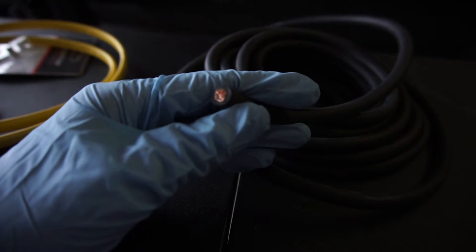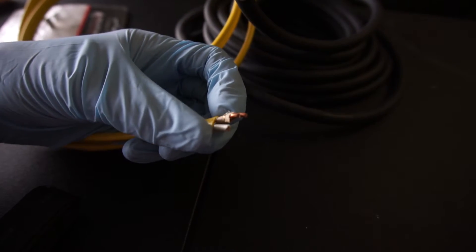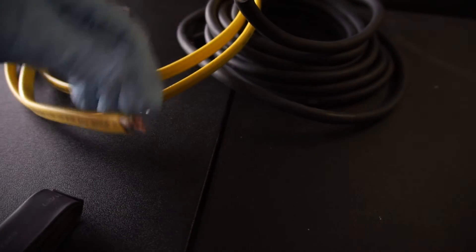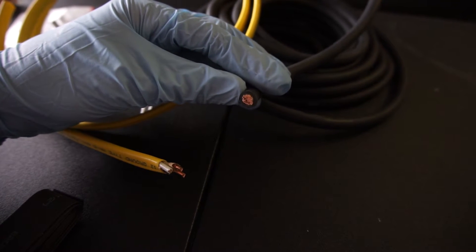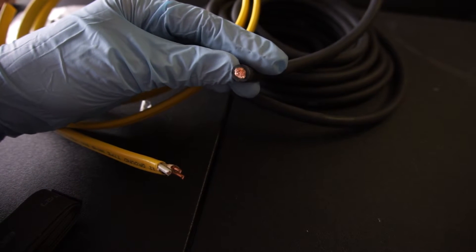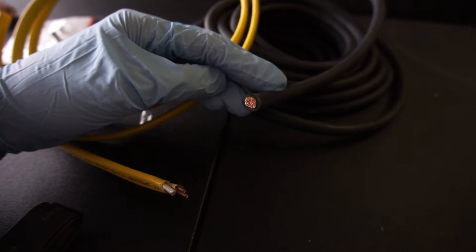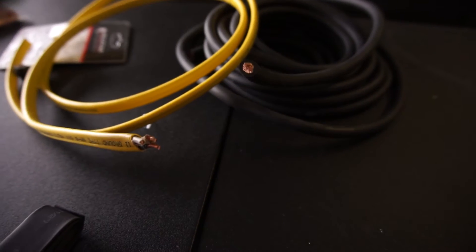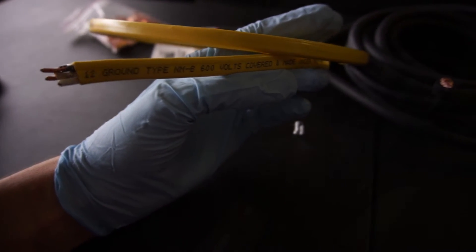For this application I'm using welding wire. Don't go to Home Depot and buy household grounding wire — this wire does not have enough strands to be rated for high amperage and you're just asking for trouble. The reason I chose welding wire is because it's pure copper, has high conductivity, low voltage drop, it's highly flexible, and it's oil and water resistant insulation. If you don't think it matters, then hey, go for it.